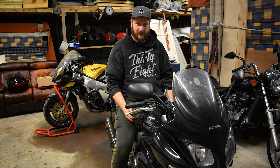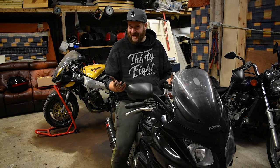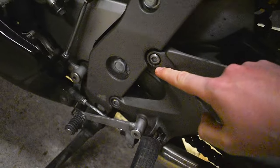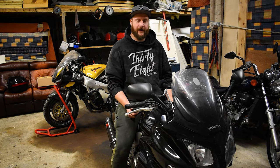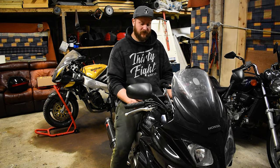So what do I think? The fitting actually isn't that bad — I know I got a bit stressed during it, but having a bad day. If you attack this the right way: take off the rear wheel, take off the rear hugger, the side panels, and the seats — it's actually not that bad, it'll be a quick enough job. Just make sure you tighten your chain afterwards because obviously if you change your shock it's going to be different. The one thing to watch out for is one of the small bolts on the rear hugger — it's a bit of a pain. On screen now: the left hand peg holder — take out the two bigger bolts and just move it out so it flexes enough to give you a bit of room. I would highly recommend doing that; it just makes everything easier to get that bolt back in because it's a bit of a nightmare. Other than that it was okay.